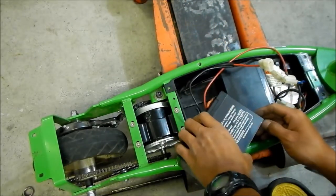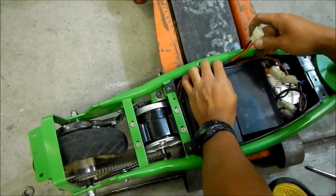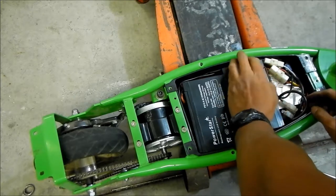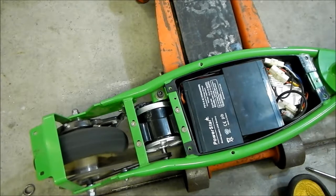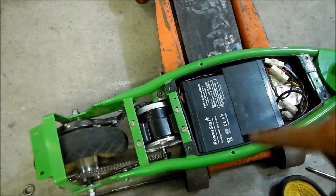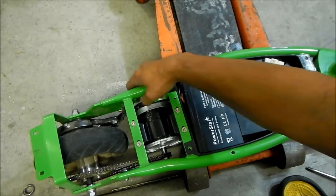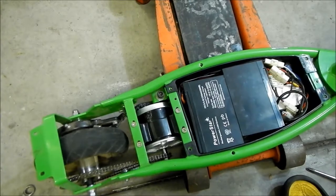Battery's in. Let's go put the motor connector on top. Yeah, everything barely fits, man. It was still on too. There it is — everything's all in there. We don't want it to derail itself. I think it'll be okay. We'll have to test it and hopefully the chain will stay on. Another issue is this wire is touching the motor — if the motor gets hot enough it may melt the wire, but it has a little jacket on. I'm gonna go put the scooter back together and speed this up. You put the bar back in, then the deck on, then all the screws for the deck.